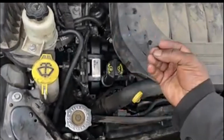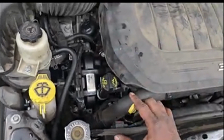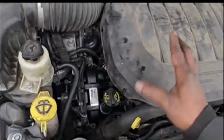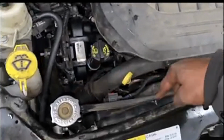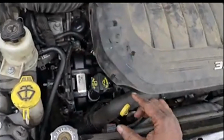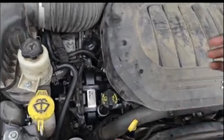So I'm going to evacuate and pull it down on the vacuum, guys. Don't just dump Freon into the atmosphere. While under that vacuum, I'm going to check it for leaks and see if my gauge drops, because remember, we had the condenser unhooked and the compressor off the car, so the system was open. If there's no leak, I'm going to recharge it.